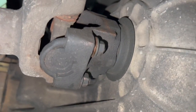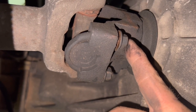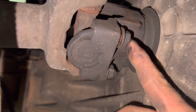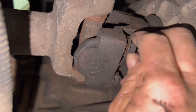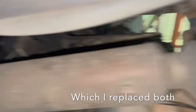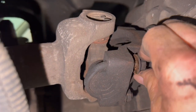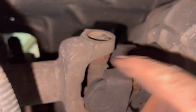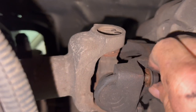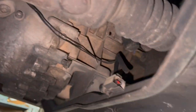This is supposed to be a 13 millimeter, but I'm finding the half inch wrench fits just as poorly on it, so I'm going to use a 13. I've decided to take the front driveshaft out as well because I want to check the U-joints and make sure everything along this drive line is in good shape. It'll also get it completely out of my way of the cavity I need to drop the transmission through, which means this big bar along here is going to have to come out too.